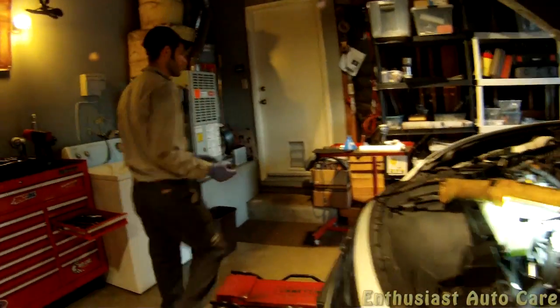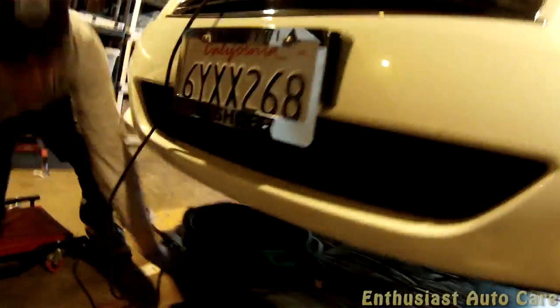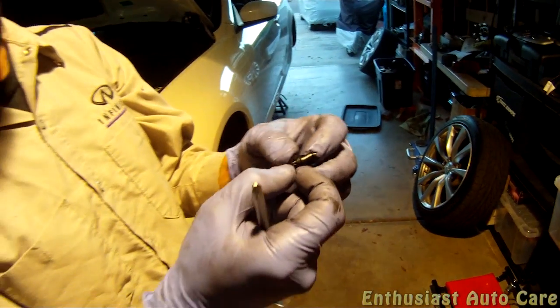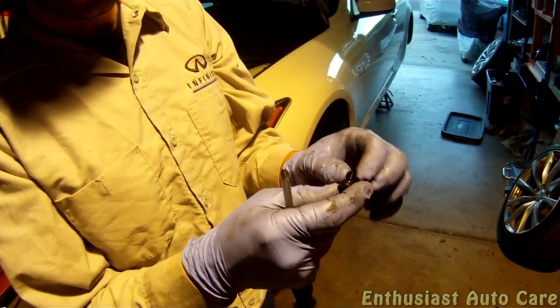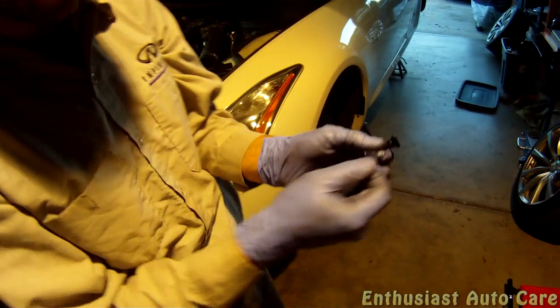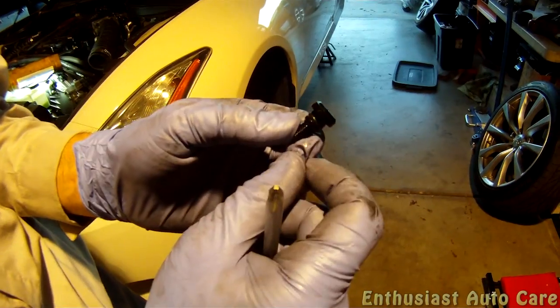This drain plug has the same type of situation going on. Let's take a look at the drain plug. Right here, it's right here. The radiator. Again, pretty much the same situation. These are actually the same O-rings as used on the first generation Gs, and I will actually go ahead and replace this one with a new one for a better fit. You can see this one's kind of flattened out a little bit. It probably won't create as good of a seal.